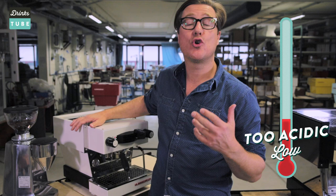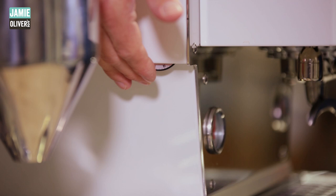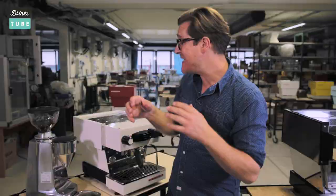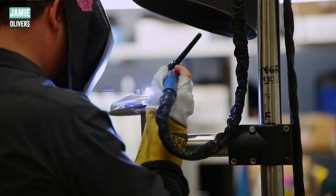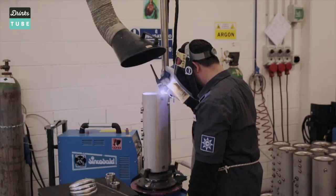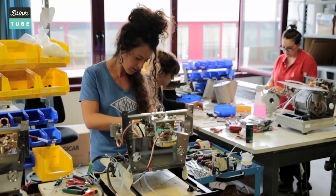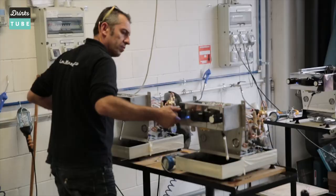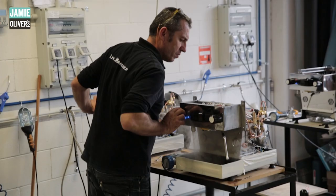On this domestic machine, you can adjust to your preferred temperature right here. You also need the water to be at a particular pressure to control the flow rate through the ground coffee — for espresso, this can be around nine bars. The water is held at pressure in the boiler, so these things have three millimetre thick walls of surgical grade stainless steel, put together with some pretty serious welding. Every machine they make here is built by hand and rigorously checked multiple times before it's allowed to leave the factory. The technicians make sure the brew boiler doesn't lose temperature or pressure, ensuring consistently good coffee.